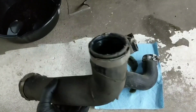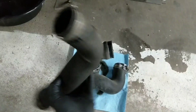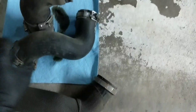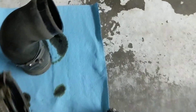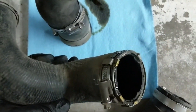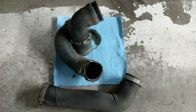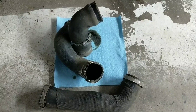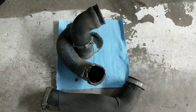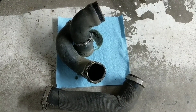I just pulled off the other two pieces of the side mount intercooler piping on the passenger side. This is the top one — there was no oil in it, so that was good. When I pulled off the bottom one, some oil did come out, not too much, so I'm feeling okay about it. Nothing came out of the bottom of the turbo, which makes me pretty happy. If anyone knows about this, please drop me a comment. I've personally changed out the PCV on this car two or three times in my ownership, and there were a few times before that too, so I think it's okay.